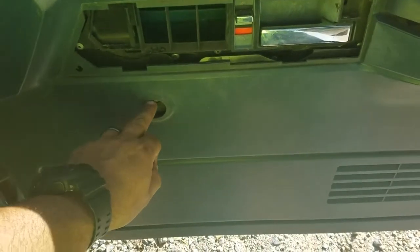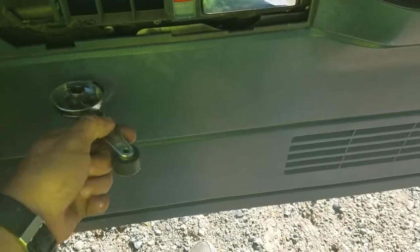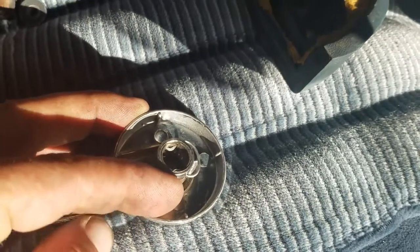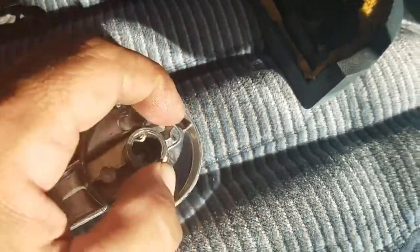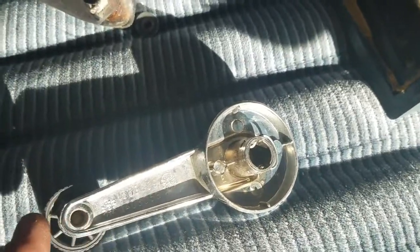That's all the easy part. Getting off the window crank is the trickiest part. If you have a manual crank, it goes right here — on the truck it's got this little clip right there. You have to be able to pry this lip, push it off, and then it'll unclip. The clip is typically facing in the same direction as your handle. There are other videos to help with removing the door handle on a Chevy truck — this is primarily a mirror install, but just so you know, removing the window crank can be a little challenging, but it's actually the hardest part of the whole install.